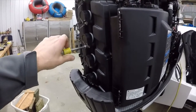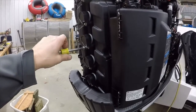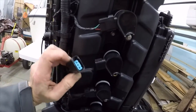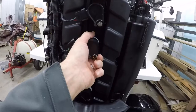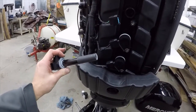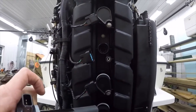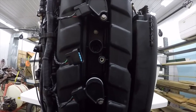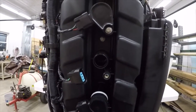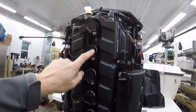With an 8-millimeter or five-sixteenths, you can remove these bolts that hold in the coils. These right here you just push down and pull, and then you can pull these off of there. Always good to inspect them — make sure you're not seeing anything wonky. Up in there is the spark plug. We want to take all of these off — all six of them.